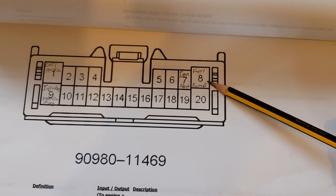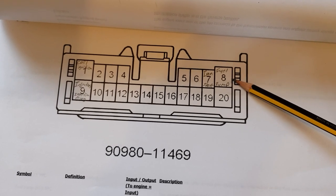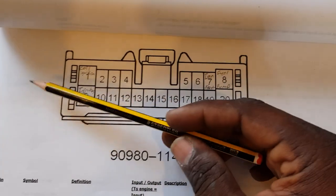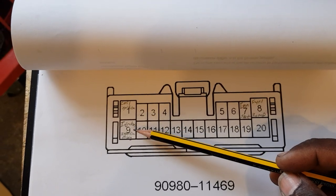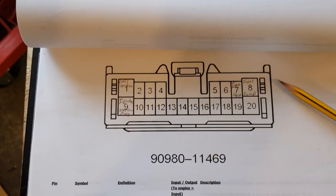I've made a label — this is the fuel pump. The fuel pump is going straight from the car itself, using the fuel in the tank. This one here — ignition side pin 7 — is ignition power to the coil, and this is the relay. All of these are just positive: number 1, number 7, and number 9.